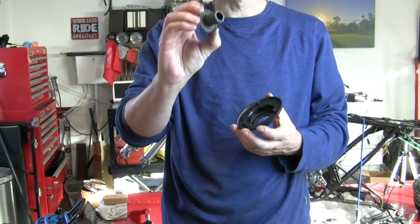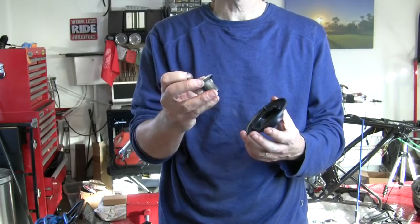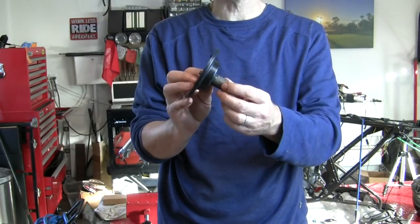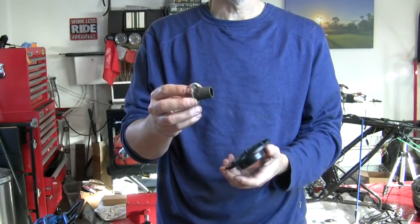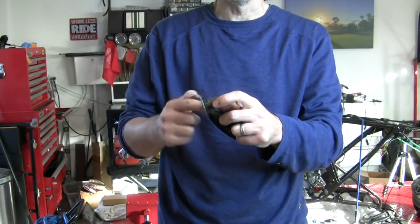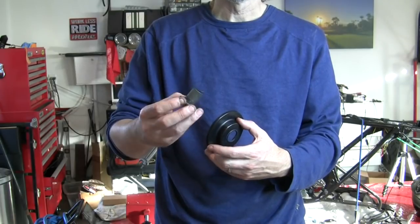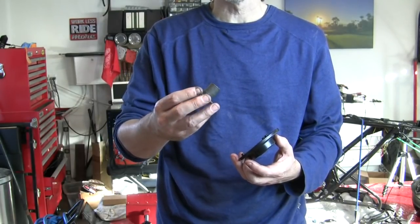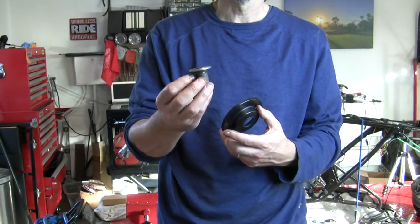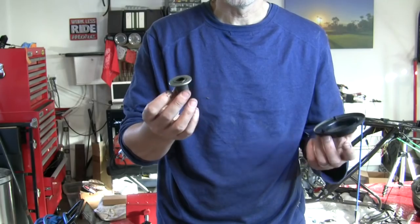So I'll just add that this spacer is a bit of a special guy. I don't know that you would have to have it with this flange on here, but this is living inside here. This plastic cap just snaps off of the hub. Careful with these plastic tabs inside there. This guy just protects the wheel bearing from any sort of moisture that would come in through this gap here. I guess it's your call how you're going to protect the bearing from moisture if you didn't have that and you just built a spacer, a big washer maybe that would fit around the spacer. I'm assuming you're building one if you want the measurements, so maybe that assumption is wrong.